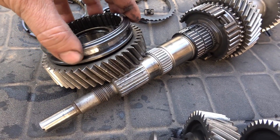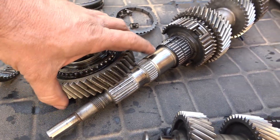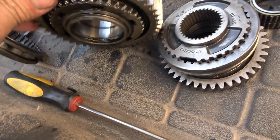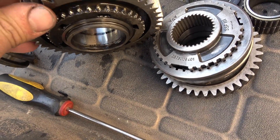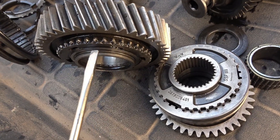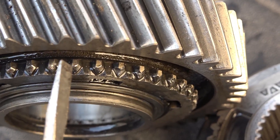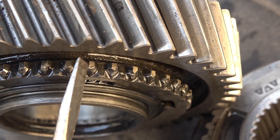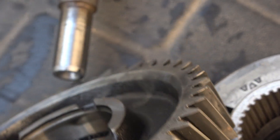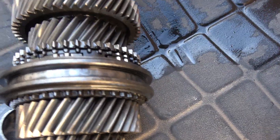Most drivers in the United States are not good with manual transmissions. They force first gear when slowing down, going from second to first. To engage first gear, the car has to be at a complete stop — if you force it, you'll grind the gear. This transmission has a delicate design where the dog teeth are extremely short, which is why it shifts so smoothly, but it can't tolerate abuse.